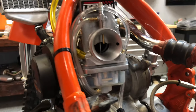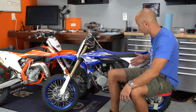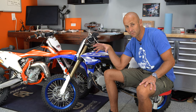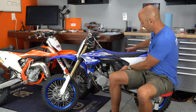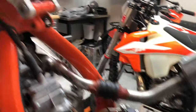Installation on these things is not difficult at all. I took the fuel tanks off both bikes — you unbolt the radiator shrouds, take your seat off, and take the fuel tank off. On the KTM, I left the silencer on since I'd done some high-temp silicone there to keep it from leaking. Then I took off the subframe — two bolts on the bottom, loosen the bolts on the top, and swing the subframe up and out of the way. On the KTM, I had to take one bolt out of the shock and swing it up to get the room I needed.